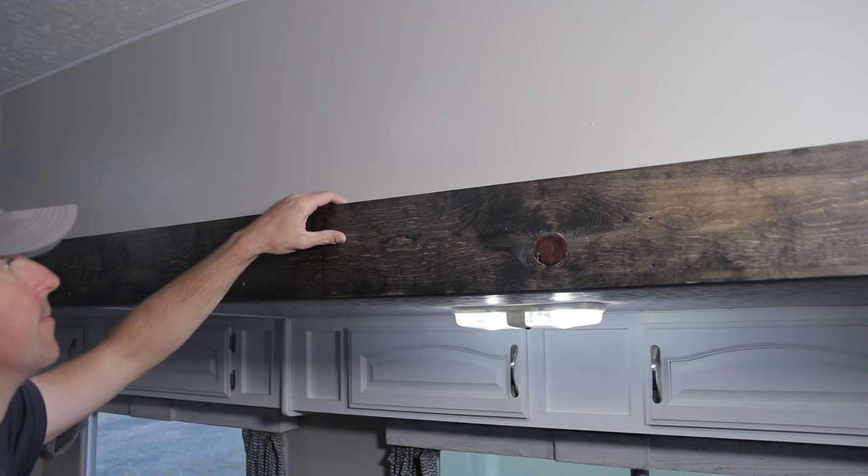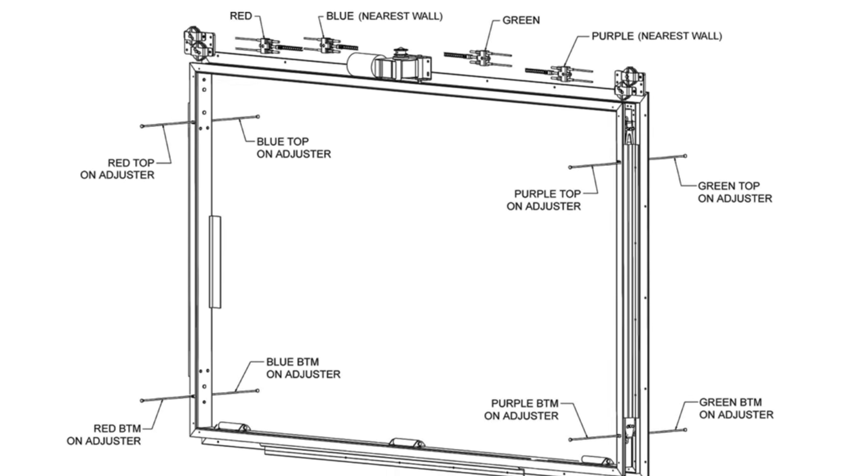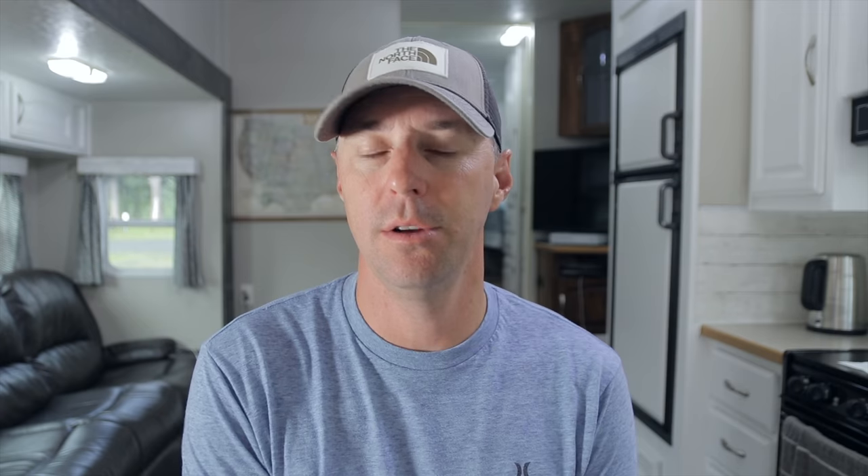For the cable-type slide mechanism, you want to really inspect it — check all the pulleys since the whole mechanism is above the slide on the inside. If there's a squeak in the pulleys, you can put a little oil in there, and check the tension. Spray lubricant on the outside and clean off the wires — they should be stainless steel so they shouldn't rust, but silicone lubricant keeps them clean so gunk and sand don't get into the mechanism. Keep the outside parts clean and check the ones above the slide area, and maintain your seals just like we did on ours.